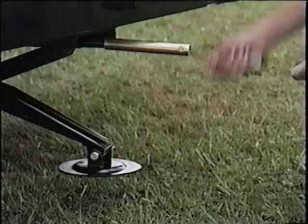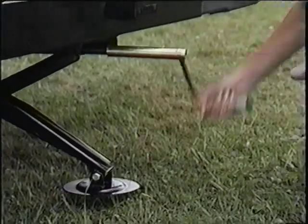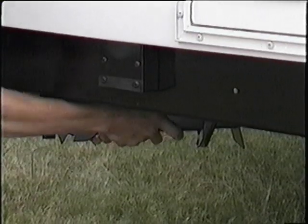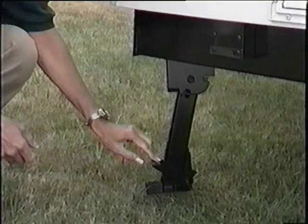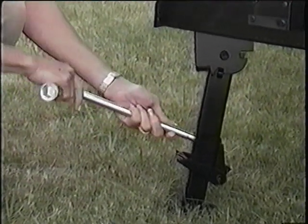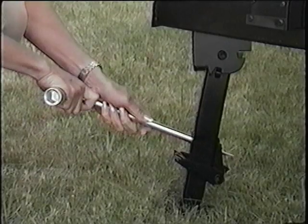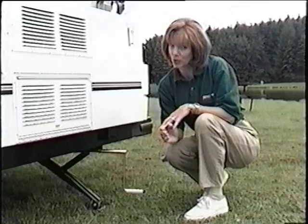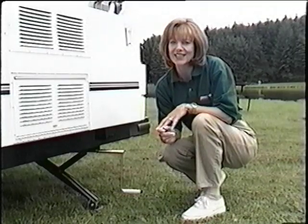After the roof is raised, stabilize the trailer by lowering either the crank-down stabilizers on the Grand Tour Series or the friction jack stabilizers on the Destiny series. Be certain that with the friction jack stabilizers, the handle is inserted into both holes when adjusting the height. Never use the stabilizers to take the weight of the trailer off the tires.